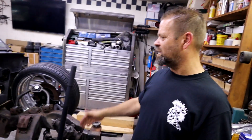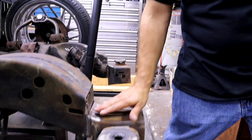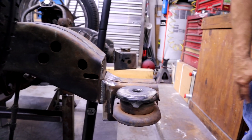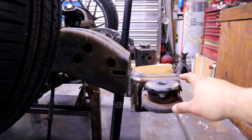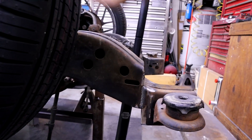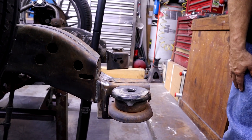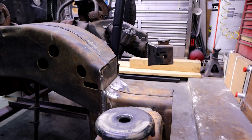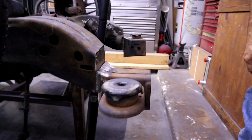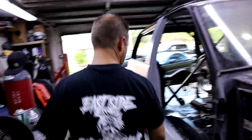After building the center rails in the front, you have to cut this and lower it down two inches so you can get the core support down to level out with the rest of the truck. You're basically lowering the front end — body dropping it. This is your body mount, so it will all be sunk down about two and a half inches. We raised the front up two and a half inches and then lowered this back down to make it level so the fenders can all bolt up the same. He cut it straight off, lowered it to the right dimensions, and we'll be boxing that in once the frame comes out from underneath the body.